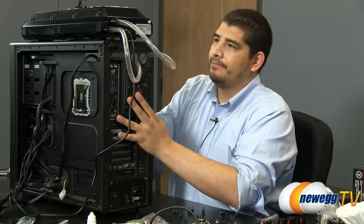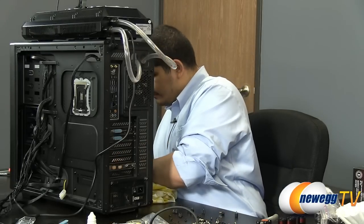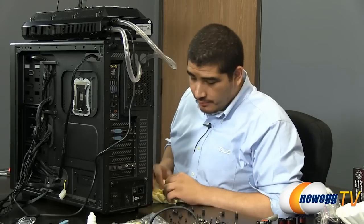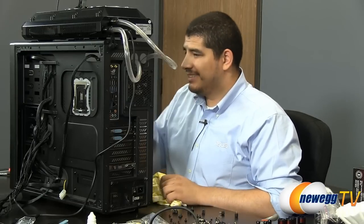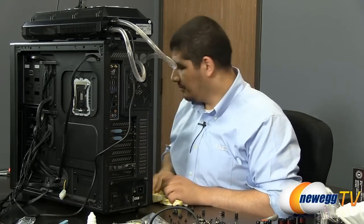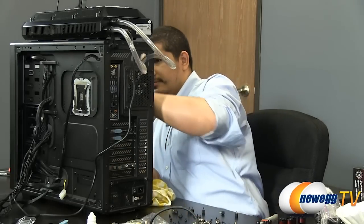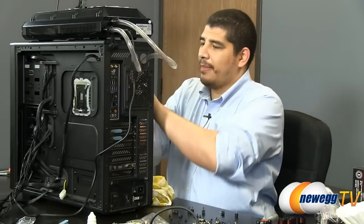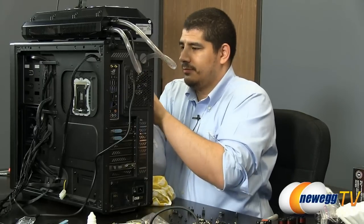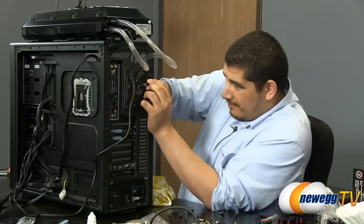Question for Paul. I recently installed an SSD, a Crucial M500 240 gig, and forgot to enable AHCI. How important is it to reformat and enable AHCI? You don't need to reformat. Fortunately, there's a BIOS change you can do.